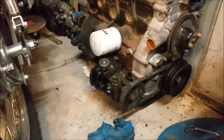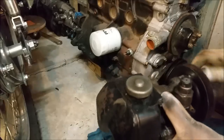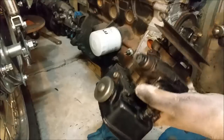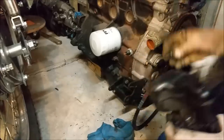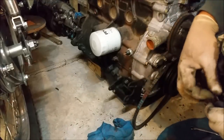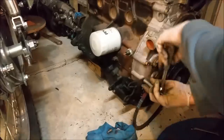I'll just take that bracket off and have another look. Isn't that a delightful looking little pump - it's kind of old school. Most likely Japanese, these were fitted to Scorpions and that sort of thing, but you never see them on Sigmas. People have asked me why I want power steering on this - the steering on these things is so heavy and revolting, not like a little four cylinder car should be.